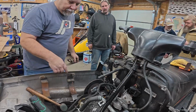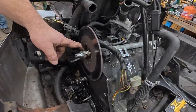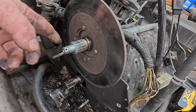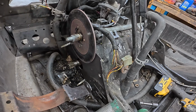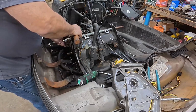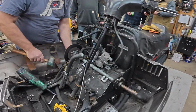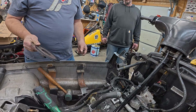Okay, come over here, Dennis. We're gonna have to... This is all right. Nope, we aren't gonna have to get the grinder out. So see, there's a ring right here and a ring right here, and these are sealing rings, and there's an O-ring in there too. But they're just a light press fit. So this one we'll just leave on the drive shaft unless we got to change the drivers, which probably don't. But this one is already walking off. I mean, very gently massage it off, and now in theory that should come out.